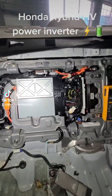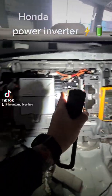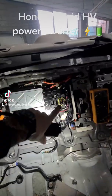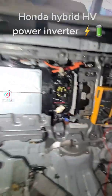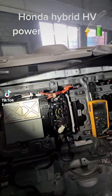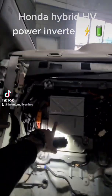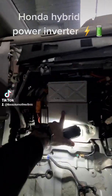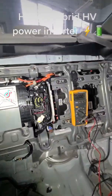We're going to be stripping this whole assembly. The batteries run from where that styrofoam is back here, and we're going to take all of this out — all the harness and everything has to be unpicked. Most of it comes with. We'll remove these four main bolts: one, two, three, four, then lift this whole assembly forward and out. That can then get stripped down. This here is our hybrid control module, that's our DC-DC inverter, and that's our aircon control module as well.